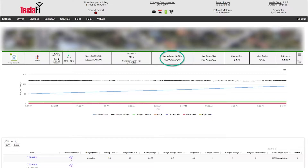Now back to the electrical performance. The voltage was well maintained, starting off at 121 volts and averaging around 118 volts under load for the 26 hour and 58 minute charging session. At 12 amps, this adapter supplied the vehicle with an average of 1.42 kilowatts and 4.72 miles of range per hour of charging. During the session, the charger consumed 38.35 kilowatt-hours of electricity and added 31.41 kilowatt-hours to the battery itself, giving an overall efficiency of 81.9%, which is really good for a 120-volt charger.